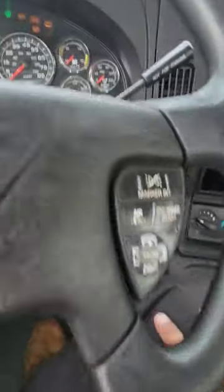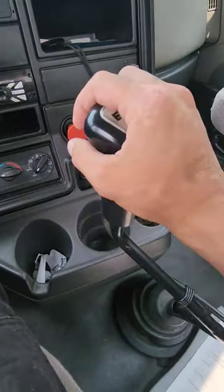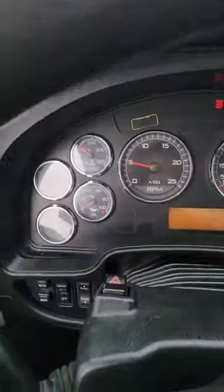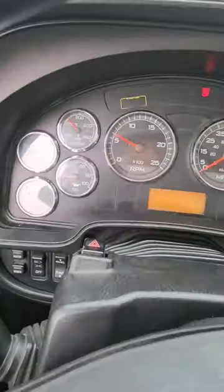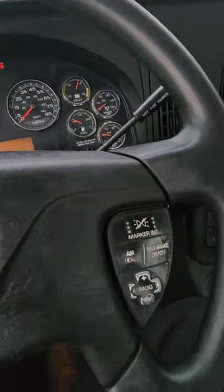The truck has to be on. So again, sweep the gauges. You're under 90 PSI. The truck is not in neutral. Put it in neutral. Both of my valves are out. Go ahead and start the truck. Oil pressure came up within 3 to 5 seconds. If it did not, I would shut the truck off. My ABS light blinked on and off, telling me it's working properly.